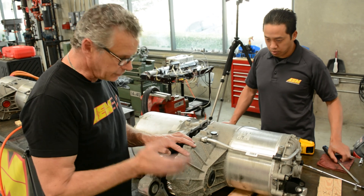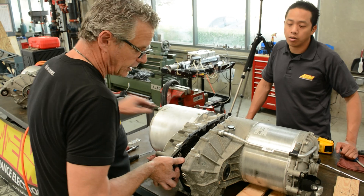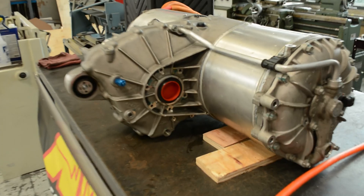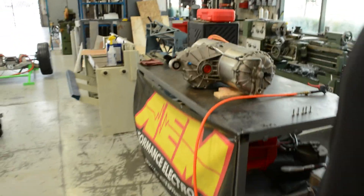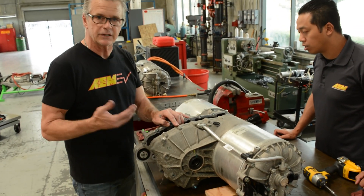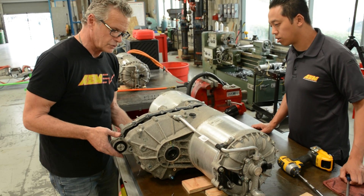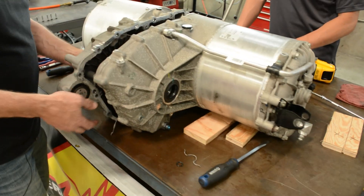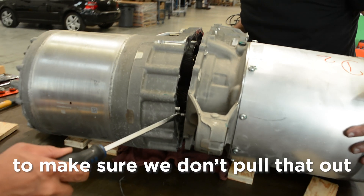This is a pretty cool conversion because this is a much newer base drive, and that's an earlier performance drive. If you notice down in this area, there are some machined flats, and on the other one there are actually holes — so there was a carrier bearing for the differential. Knowing that Tesla wanted the diff to sort of stay on that side and stay engaged with the pinion makes disassembly a little easier. As Sam and I brought the cases apart, I used a larger bar to just push the diff back to maintain it in that carrier bearing on that side, so your pinion bearing stays seated and allows us to get it apart.